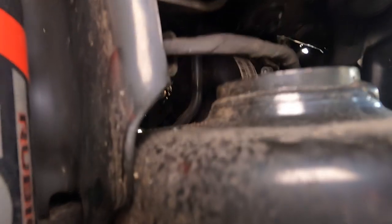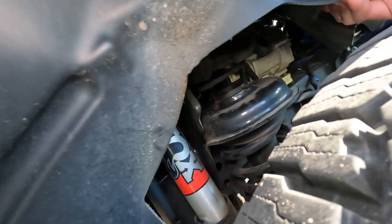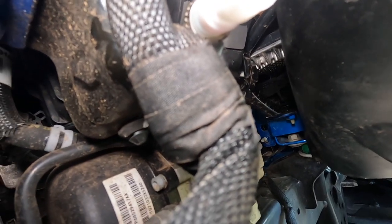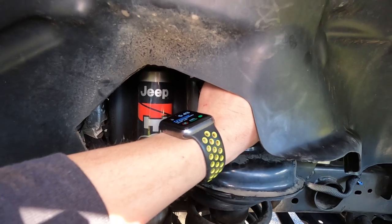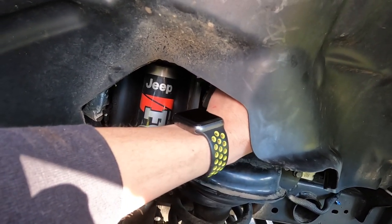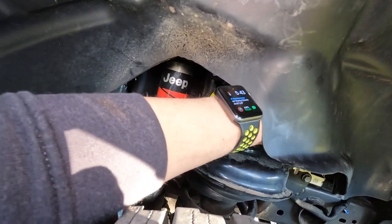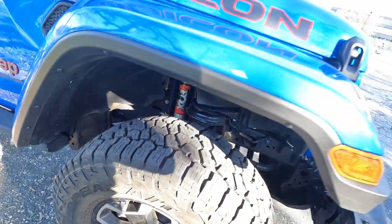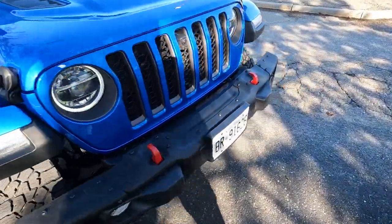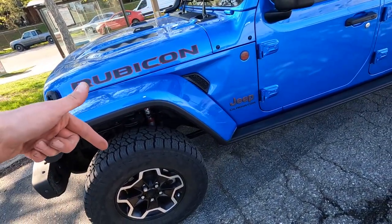The drain is basically just over here underneath the fender. You can reach into your fender and it's right there — easy to get with your hand. You would just turn it to get your valve open or closed depending on what you're doing: if you're fording water, close it; if you're off-roading, close it; if you're daily driving, leave it open. It's a convenient spot, and you just have to remember — if you don't, now you have a straw at the bottom of your air box that's going to suck up all the water.